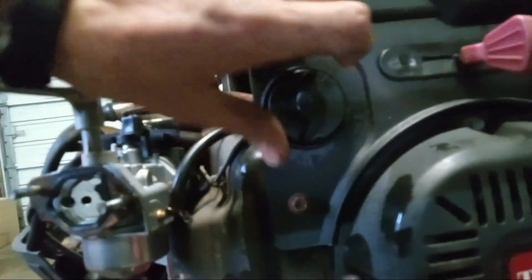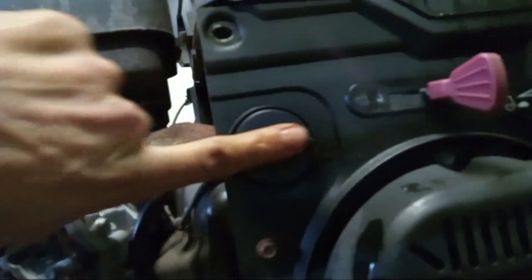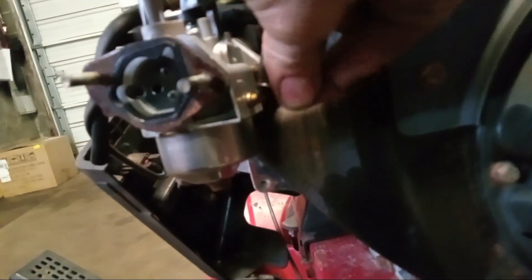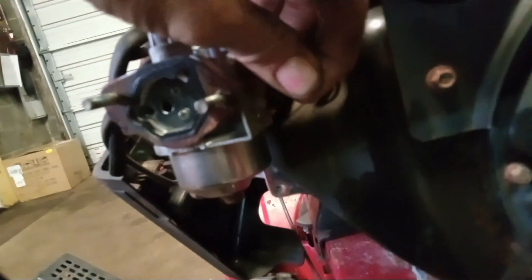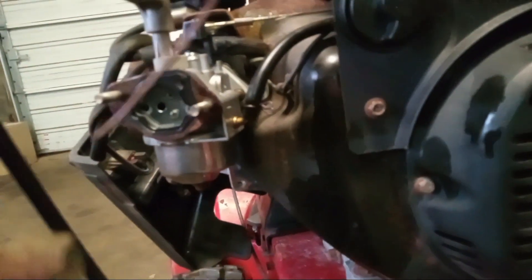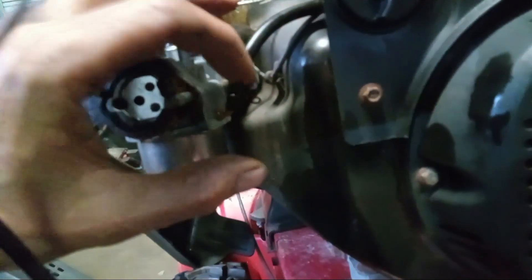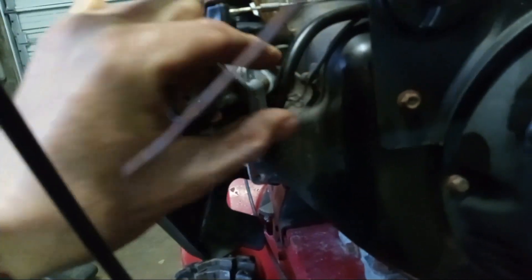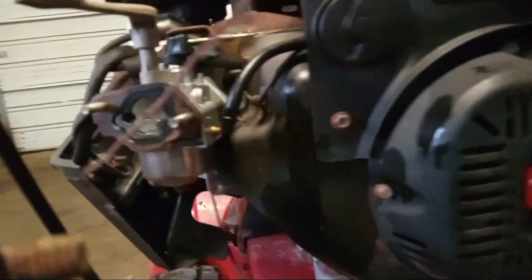Come over here — the gas is off, but if it's horizontal like that you want to turn it and shut the gas off. You will see a mark on the side which pretty much shows you where it's on and off. Turn it off, because this hose here does have a little clamp on the bottom. We want to squeeze that in — you may need pliers. Squeeze that in, pull that clamp up. We're going to need to get a little bowl, because as soon as we pull that line off you are going to drip some fuel out. Get a little bolt that will fit within this hose — don't put too big of a bolt because you don't want to stretch or crack the hose.